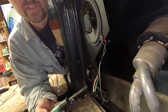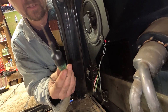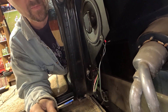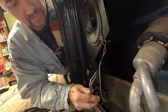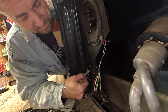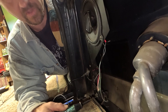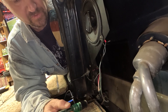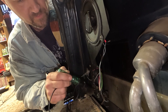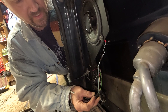So back here we are on the driver's side and I just pulled the little panel off the back of the Wagoneer. All I have here is a basic little test light. It has a point on one end, it's got a ground on the other. What it's going to do is light up that little tiny bulb when there's actually power going through it. Because what we want to do is actually find out what the wiring diagram is of this — I can just test it out. Now, I do have my left blinker on. I'm just going to go ahead and ground it and touch each wire on this plug for the actual lights itself. There we go — I know that this one right here is actually the left blinker.